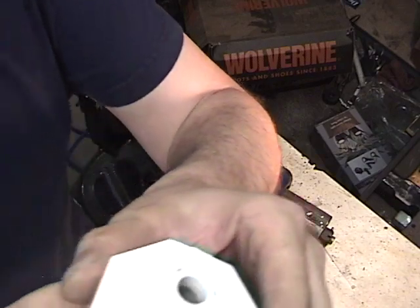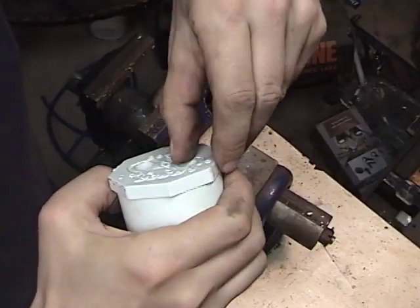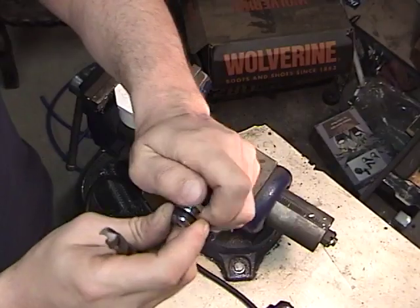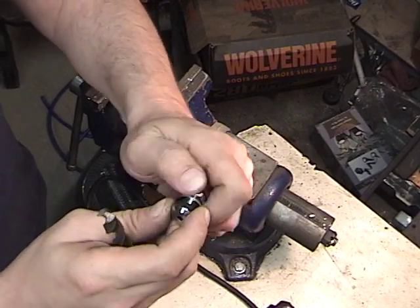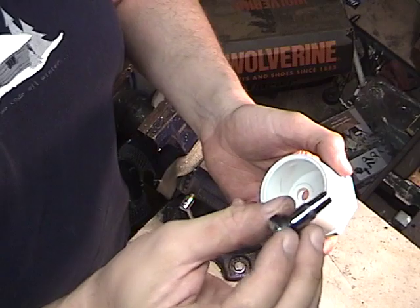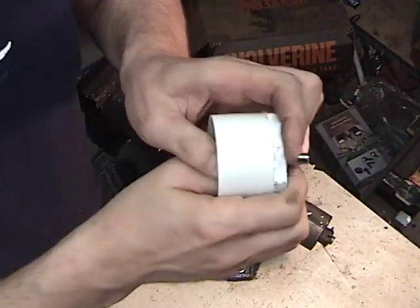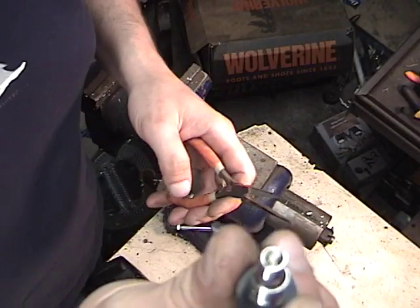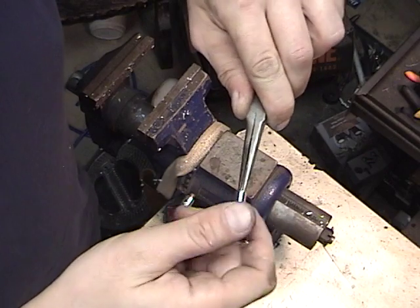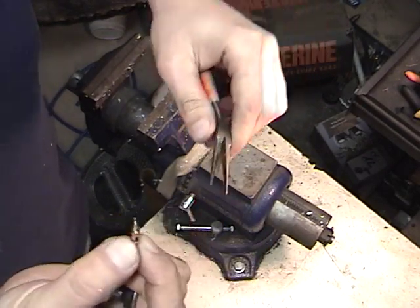You'll see why we drilled only slightly into the cap — there's plenty of thickness there, but we just wanted a smooth surface. Take your edges off and clean them up. Then you take this valve stem apart — it has a rubber gasket on it and each one fits down inside that hole. On one of the valve stems, you'll see the Schrader valve that's down inside. You can do this with just needle-nose pliers if you're careful — pull the Schrader valve out of one of them.